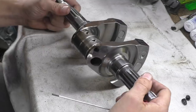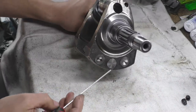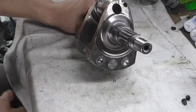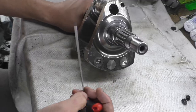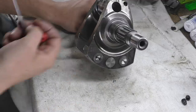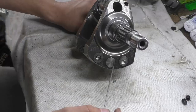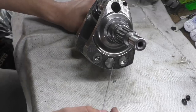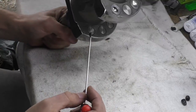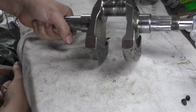Other design aspects is, yes, it is a shared crank pin. We've already gone through the counterweights and why they put counterweights instead of just drilling it, is so they can add and remove if and when is necessary. If you have titanium rods, which these things do, then you can lighten this out if you want to exchange that. Just say you're doing something like maybe turbo or supercharging it. You'd want more mass because your rods are going to have to be a bit beefier, so you can basically knock these out and put brand new blank ones in. These go all the way through, as you can see, so you can just put this in a jig and force these out and pop these out.